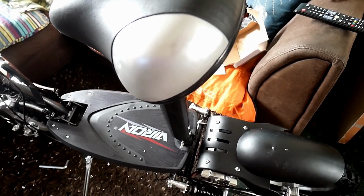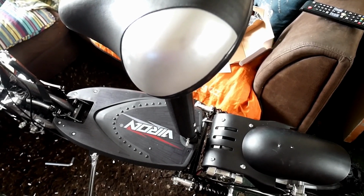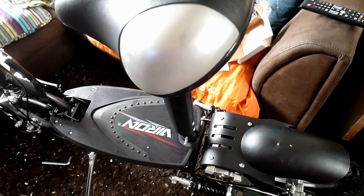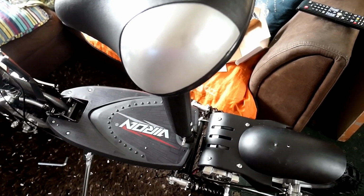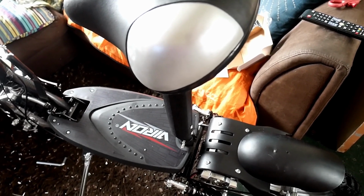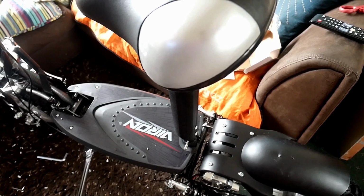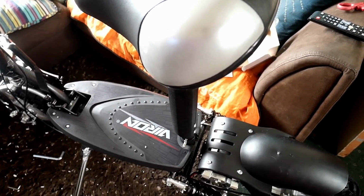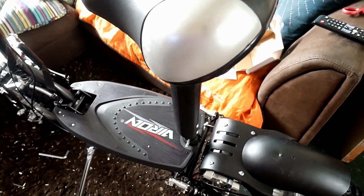Now I've seen some on eBay, people make them with various connections and that, and various battery companies selling them. You can pick them up for over £100 for a 36 volt one. Obviously you'd want over 10 amp hour and it'd fit in this compartment. So if you was interested in that, you'd search LiFePO4 36 volt batteries, and that's what they are, lithium.